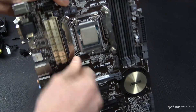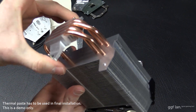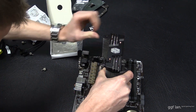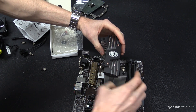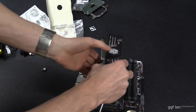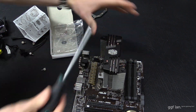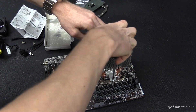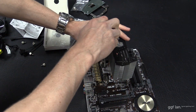It's best to do this with the fans off so you can get in to screw it down. The cooler comes with these mounting arms pre-mounted — some coolers require you to attach these separately, but these come already pre-done. These just line up on the standoffs. You might just have to loosen things a fraction to get it to line up perfectly. Bear in mind you will need to put thermal paste on when installing this.